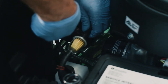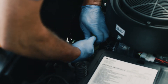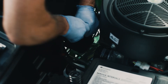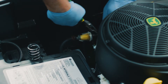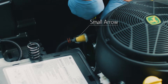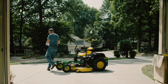Make sure there are no sparks or anyone smoking in the area. Use the pliers to loosen the hose clamps and move them away from the filter. Twist and pull hoses from the old fuel filter and raise fuel lines vertically to avoid fuel drainage. Quickly reattach the hoses to the new filter, making sure the filter arrow points in the direction of the fuel flow. Reposition the hose clamps so they secure the hoses to the filter. Clean up any spilled fuel and properly dispose of the old filter, fuel, and fuel-soaked towels before starting the engine.